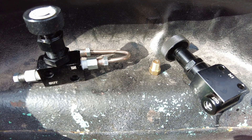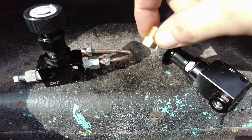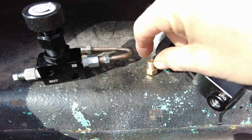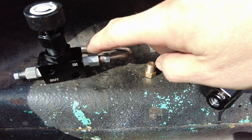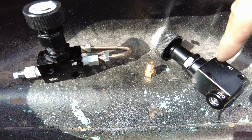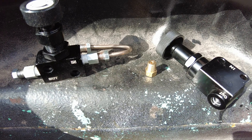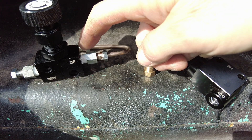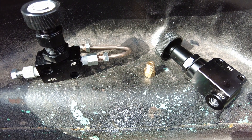If you're wanting to fit a brake bias valve without a servo, you don't have that issue, but you need to consider carefully. The first one arrived with 1/8-inch MPT fittings and needs a double flare to connect - the problem is there's not enough thread in the end of it to adapt to something else. I ended up having to buy more fittings to go into the end of this one, and they cost more than the actual bias valve did in the first place. Between that and the fittings, there's about £40 worth there and I can't use it. I've now got a second one as well - roll up, roll up, if anyone wants to buy a bias valve, I've got two for sale.